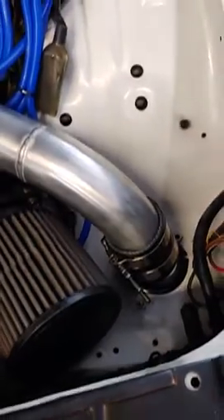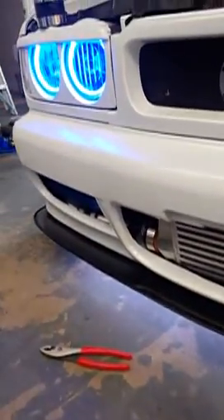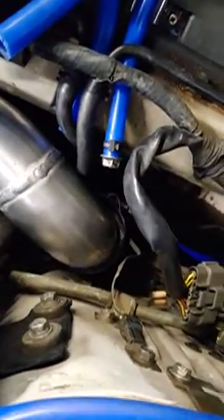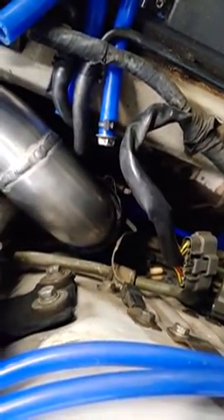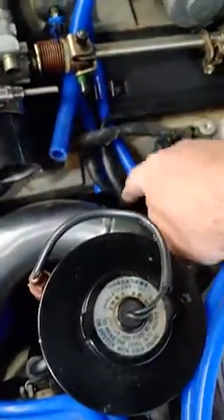The hot side pipe is installed, running all the way down and coming through into my intercooler. The hot pipe comes up and takes a nice little J-bend, S-curve right there. I've got a 1.75 to a 2.5-inch coupler, and then it's 2.5-inch piping the rest of the way through. It's bolted in solid with just enough clearance — you do have to remove the hard lines.